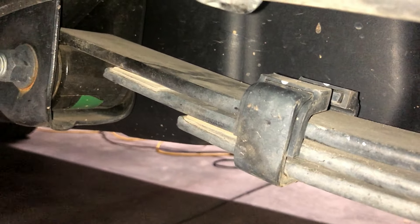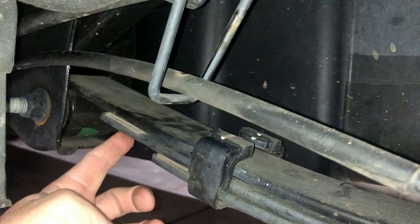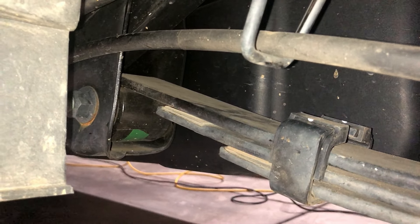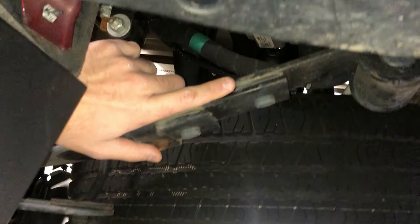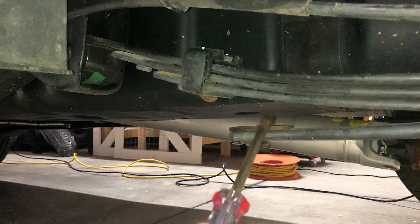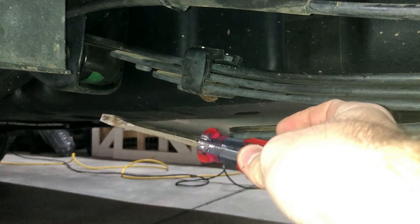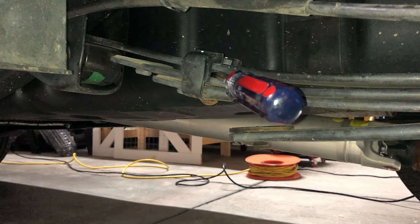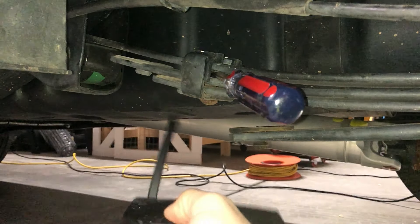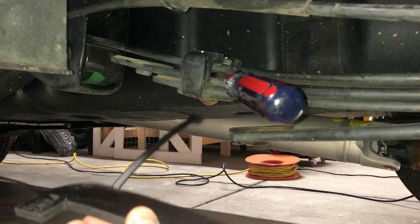On the Colorado and Canyon, the majority of the noise coming from these springs is from that top leaf and the next leaf down. There is a rubber isolator there from the factory, but it just doesn't do the trick. For this purpose, I'm going to install the Spring Thing on the front and also way back on the rear. To do this, you just need to get yourself a big, fat, sturdy screwdriver and wedge it in between the leaves enough to spread them apart. You can see there's now a nice gap where I can slide that rubber pad in and then wrap the zip tie around the top and secure it in place.